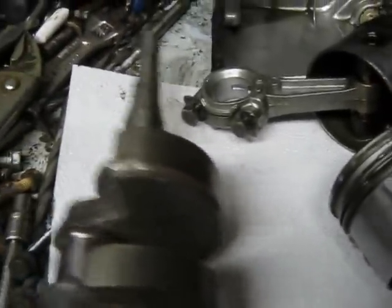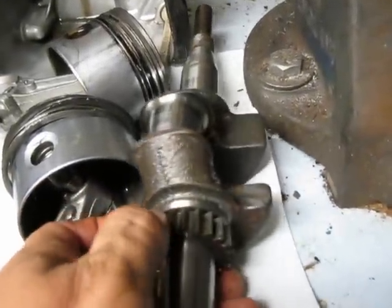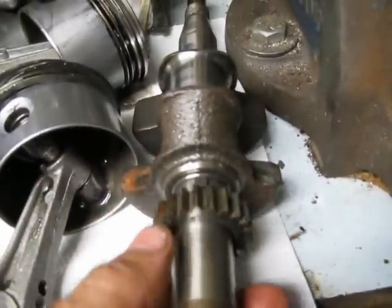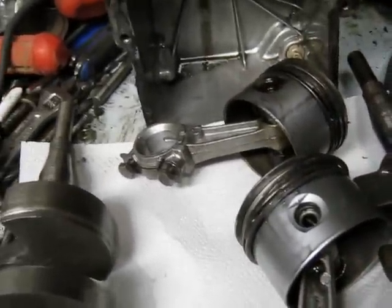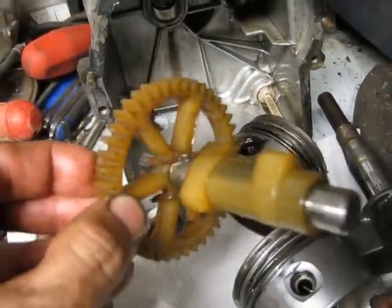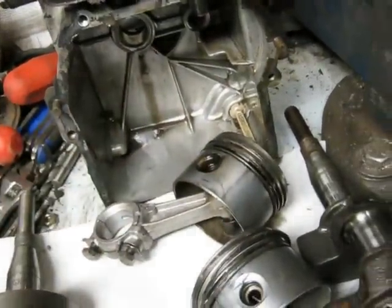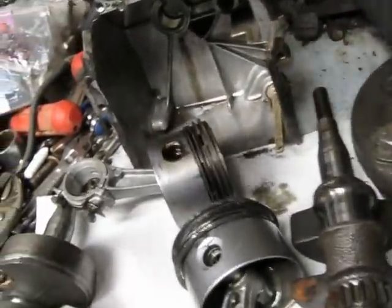All these time and money saving things they've developed over the years. I'm not a huge fan of the non-integral gear though — it's good and bad. I broke one apart on my Briggs 327, but I think I've got the solution to that. I'll be using one of these plastic camshafts — they weigh so much less that I think I had a vibration dynamic going on there.